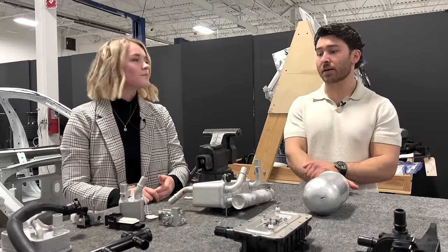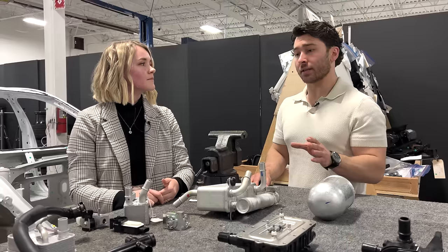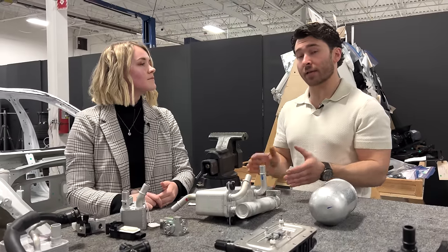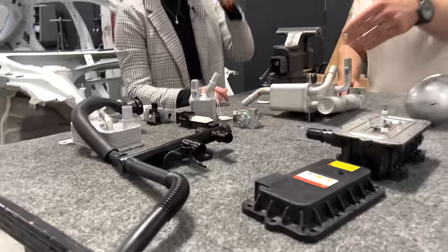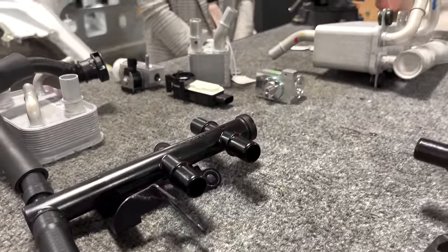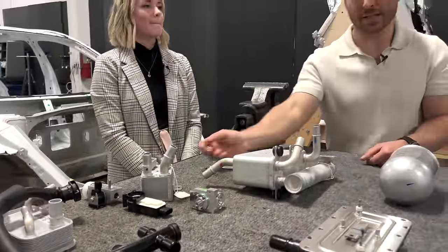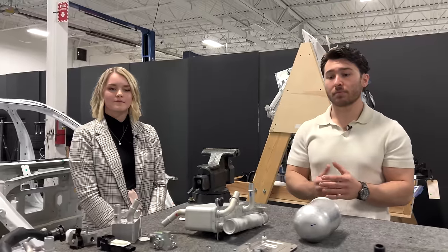Right, because the battery itself, as we mentioned earlier, the only interface that the battery glycol loop has with a radiator to the front of the vehicle is through this manifold. Yes. And through the mixing of the coolant between the low temperature radiator loop and the battery loop. So in addition to that, this chiller is effectively the primary way for the battery itself to be cooled.